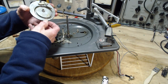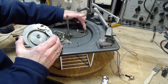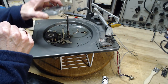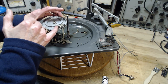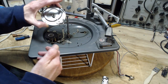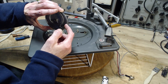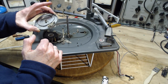See the white color on there? That's the lubrication no longer lubricating. This is the part that moves within the track, and this track should have a fair bit of lubrication on it — it's as dry as a bone. These pieces are fine — I can shake them and they move around by their own weight. Nothing needs to be done with this. If it's gummed up, you deal with it by popping it off, throwing the pieces into some alcohol, and putting them back together later. There's another riveted shaft here. If it's really stuck and somebody previously put lubrication here, you really shouldn't lubricate this because the lubrication glues up and ruins the rivet connection. Fortunately, I don't have to worry about it on this one.